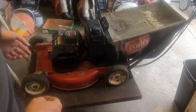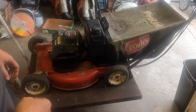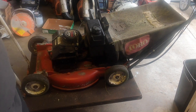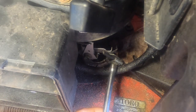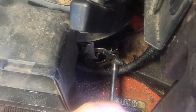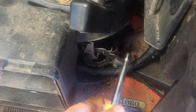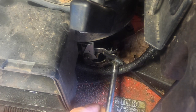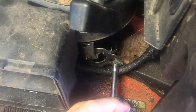So that has a new plug. I dried it out a little bit more. There's a whole lot of nonsense in there. I think I'm gonna look at the plug one more time. I looked for spark. It wasn't anything. So I looked at the cable, and while yes, it says that it's half throttle, that's because the cable wasn't in there all the way. It's actually an off. This piece kills it. So, I'm gonna take off the cable, it's frozen, see if we can't fix said cable, and then take it from there.